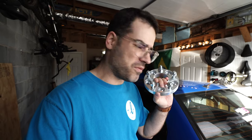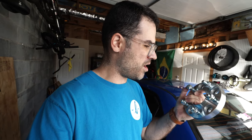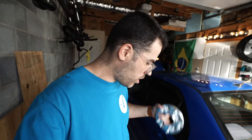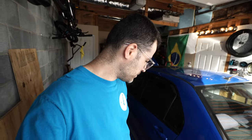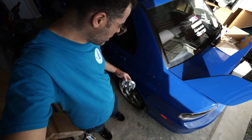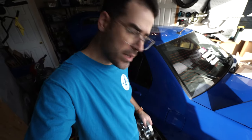Since I'm going to have to lift the car up and remove the wheel anyway, I'm going to install some spacers. I just ordered 20 millimeter hub-centric spacers from MAP. Until I get some aftermarket wheels — which are coming, by the way — I want the car to look somewhat decent. The factory wheels look really nice but they are really sunk in, so I'm going to stick 20 millimeter spacers on all four corners. The rears are actually rolled, so this should work just fine without rubbing.